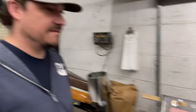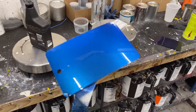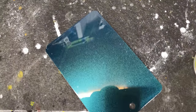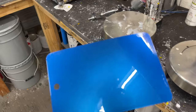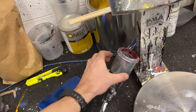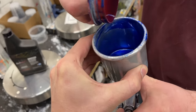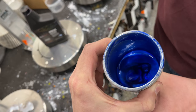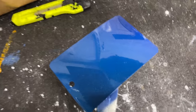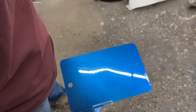That flip gave it a nice clean look — almost purple. So while we were gone, Eric was messing around. He basically sprayed the blue pearl straight over black, and then he added some blue candy to the clear mid coat. Just a couple drops of blue candy in the mid coat, sprayed over black — and that's what got us that result right there. That is crazy.